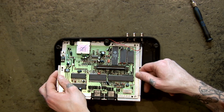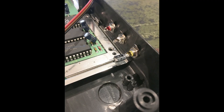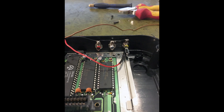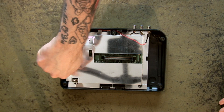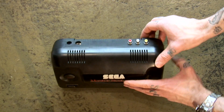You've now finished working on the underside of the board. Put the board back into the lower RF shield and put it all back into the lower half of the case. Screw all three of your RCA plugs into the case so they are finger tight. Here you can see the capacitor soldered to the yellow video plug. You will need to solder the short lead of the capacitor to the middle pin of the RCA jack. Capacitors are polarized so the short lead is the negative lead and the long lead is the positive. Solder your wire from the video feed onto the positive lead of the capacitor and once again heat shrink this. Attach the wire which you soldered to the common ground on the board to all three jacks. The Master System only outputs mono audio so you will need to connect your audio feed to both your red and white jack — do this by bridging both of these with a small length of wire. Once you've done all this, tuck your wires out of the way neatly inside the console and put the console back together. You'll now have two mono audio outs and a video out via composite.